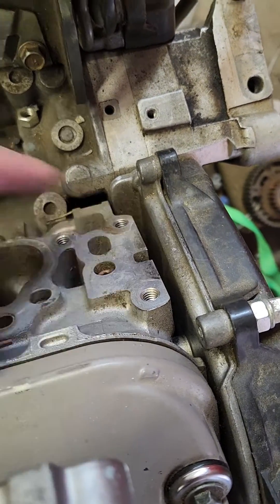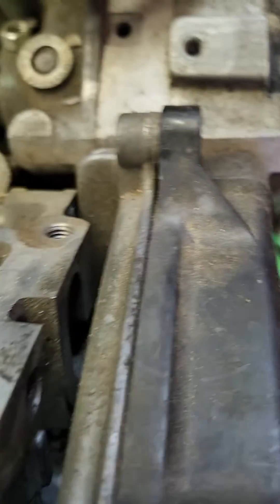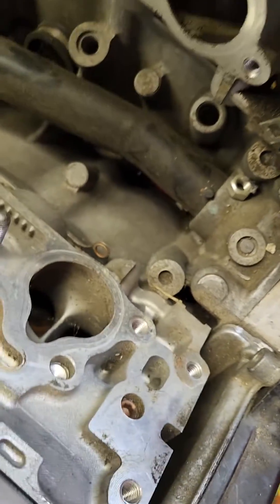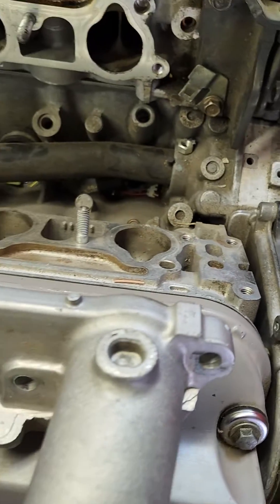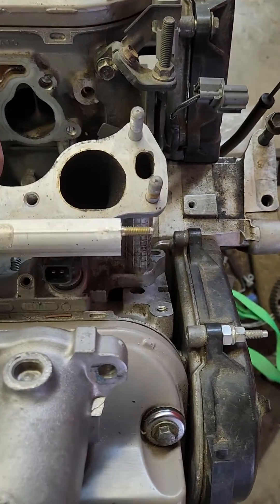You'll notice that is the same as this as far as shape goes. So you'll want to plug that down there to keep it from sucking air. That goes to right over in here — it's pretty open down through there. You'll plug that. You might plug it on this side, but your timing cover is in the way and that's really involved unless you have your engine all torn down. It's best to take that and plug it — weld it, JB weld, silicone.